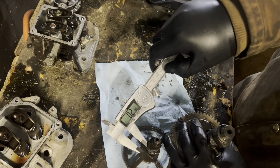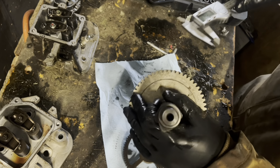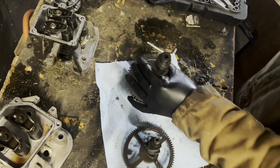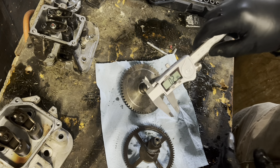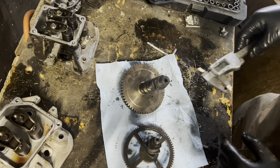Actually it's over a quarter of an inch. It may not seem like a whole lot, but you are moving a lot more oil through something that is seven hundredths of an inch larger in diameter than the Briggs.